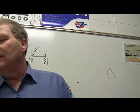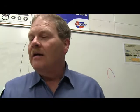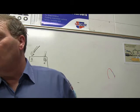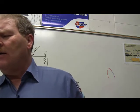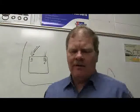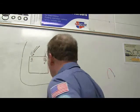Okay, now then, we're hung up on these instrument voltage regulator questions. An instrument voltage regulator is what? Is it A, a load control device, B, an insulating device, C, a type of printed circuit board, or D, all of the above? We've kind of described that. The instrument voltage regulator, the ones we're talking about, and remember, that's only on the ones with bimetal gauges, which is the really old cars.